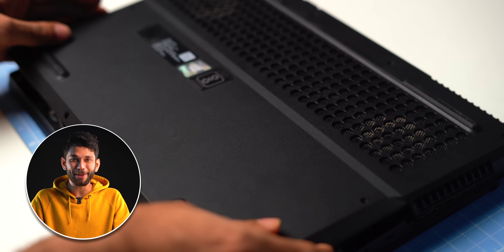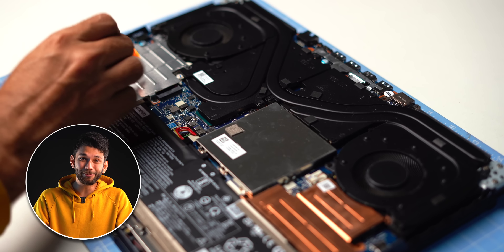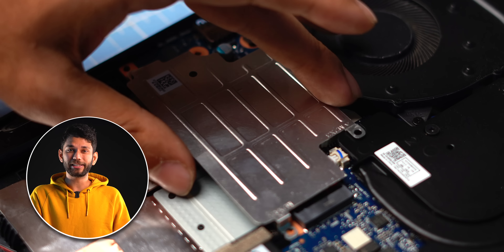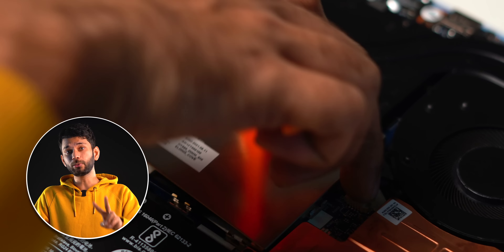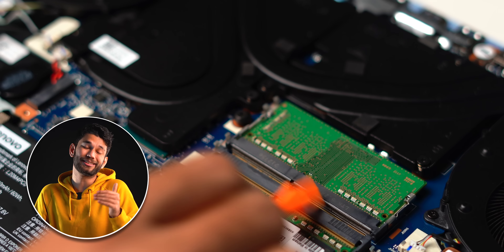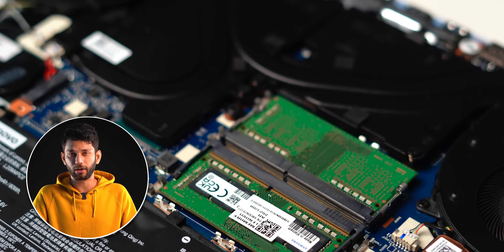Look how beautiful the laptop looks on the inside. Not many people open a laptop, but there are three metal plates to nicely cover your RAM and SSD. They did expect people to open the laptop, so you have an extra M.2 slot expandable to 1TB. You also get two RAM slots — here we have 16GB DDR4 RAM — and you can expand to 32GB by swapping out the two sticks.